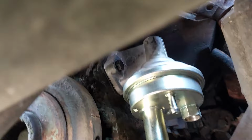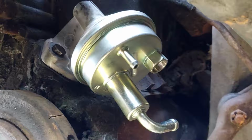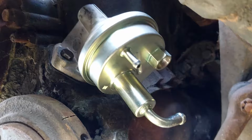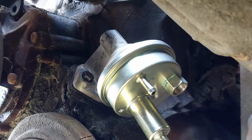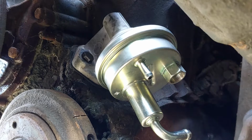Alright, got the first bolt in there in the front. The tricky part is the blind bolt in the back. And you can see here how that gasket sits in between. Unfortunately, if that gasket shifts a little bit, and the bolt pops off, you can't get back through there unless you get the gasket completely lined back up. And that is, generally speaking, the only thing that's holding me up, is that gasket and that bolt on the other side of this. Just trying to get them lined up. And this is just literally a do-it-by-feeling kind of thing, because you can't see anything. So just keep rubbing around the hole until it slides in, as it were.